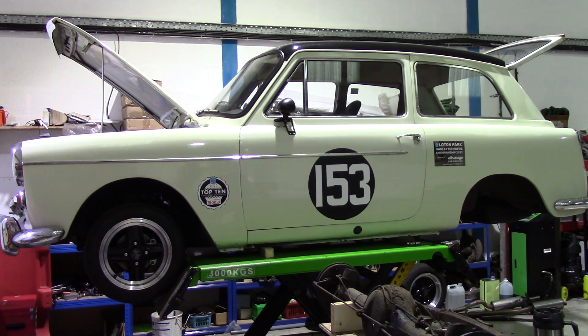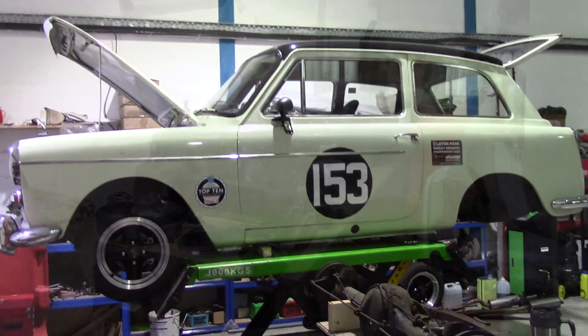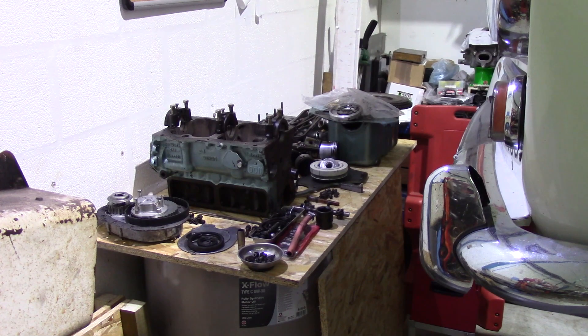It was dumping two litres in 18 miles the week before the first event, so a replacement motor was found at very short notice in the form of a stock Morris Mini 1100 lump giving around 40 horsepower. The original engine, which we'll call Blue, was a stock block with lightened and balanced bottom end, lightened flywheel, ported big-valve head with the block pocketed to allow for the big valves, a Kent Megadyne 256 camshaft, breathing through a 40 DCOE Weber with 28mm chokes, and a long centre-branch exhaust manifold into a stainless straight-through twin-silencer exhaust system.